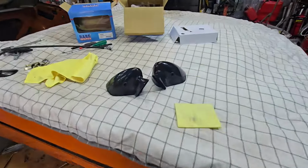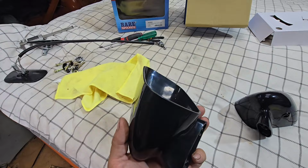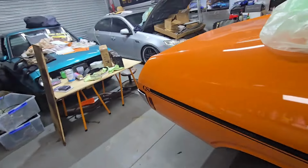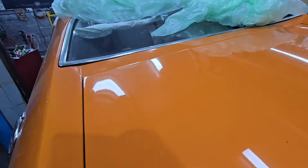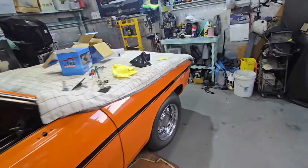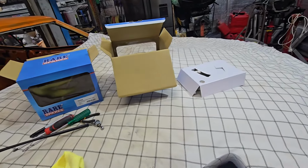There'll be a lot of moisture in there, so when it comes to painting these mirrors, I'm going to have to be really careful, make sure I get the fluid out of that air compressor best I can and use the right filters and stuff, because I've got humidity blisters right across this car months after doing the paint job. They're alright if they're only small, you just give them a cut with wet and dry, and then buff them again. I had them all out of their guard, they come up good. So you've got to be mindful of that.